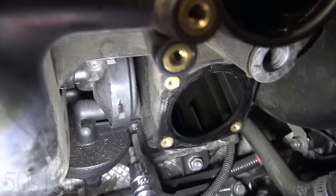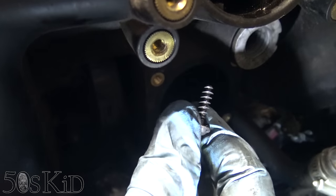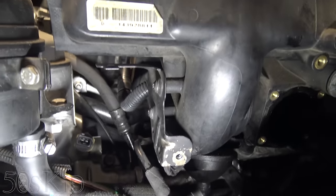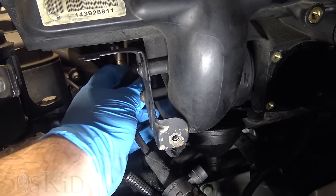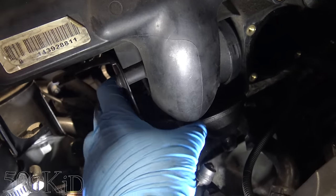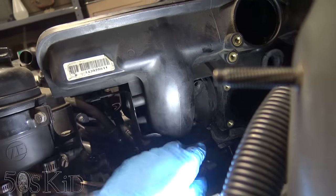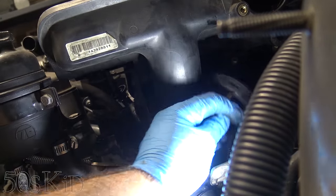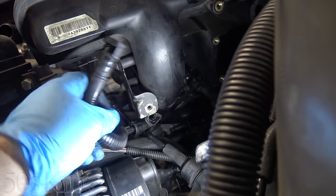Now let's unbolt our oil separator. These are special plastic bolts with a very coarse thread — don't drop or lose them. Since I didn't cut the ribbed tube, I'm going to fiddle with both pieces, twisting the tube to the down position to maneuver the oil separator out. What I did was twist the tube down a little more and the oil separator came out. I should be able to pull it off now — and there it is. There's our oil separator, and I was able to pull the tube out intact, so I can possibly reuse it.